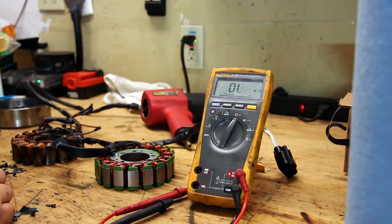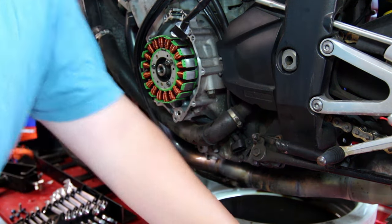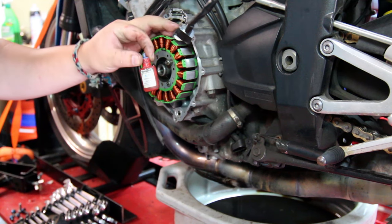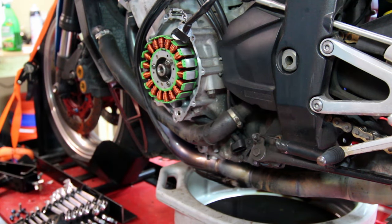At this point, there's nothing really left to do other than reassemble everything. You guys saw me take it apart, so I'm not gonna film this part. The only thing I will say is you wanna use this guy. This is thread locker blue. Every bolt that goes back inside of an engine should always have some thread locker on it, in my opinion,